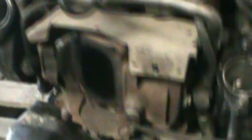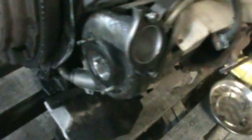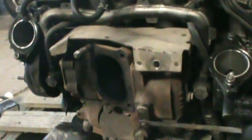So I got the air pump off. I've been taking off just the heat shields, but you can get a better look at what the twin turbos look like on this car. You can see the one turbo on the back and the exhaust side, and then the other turbo in the front. It runs off the smaller one on the front, and then I think around 4,500 RPMs that's when the second one kicks on. My second turbo in the back wasn't kicking on because of a turbo control solenoid issue.